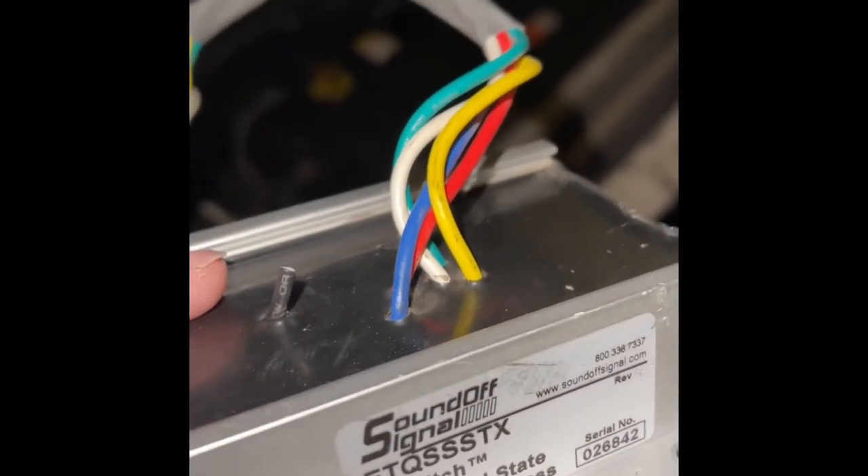And then the yellow and blue wire. The yellow and blue wire connects to your car — to that little plug right there. You can see there's a blue and a yellow wire. You'd basically just cut off that plug and splice in the blue and yellow wire from this module.